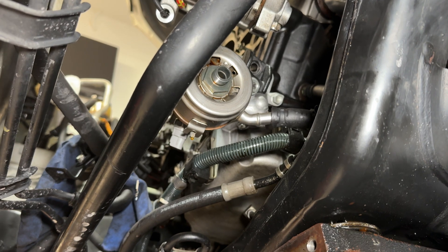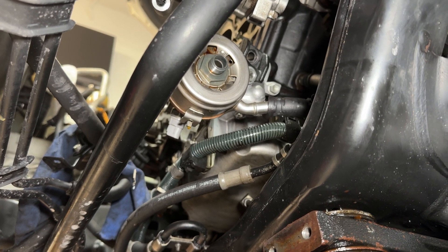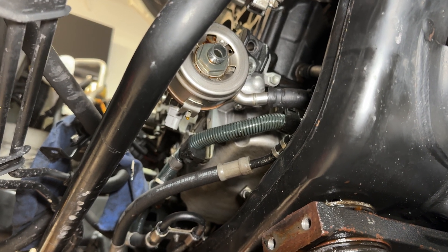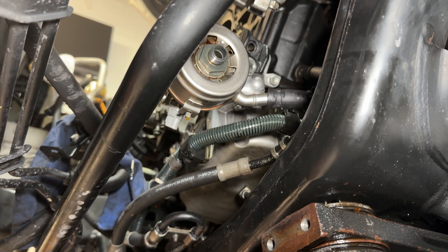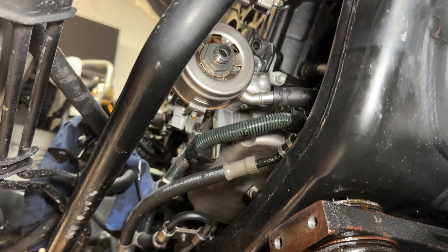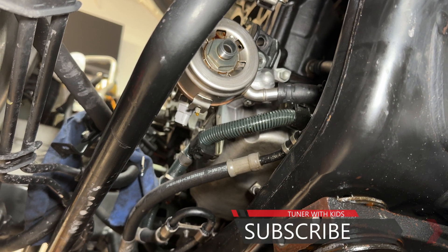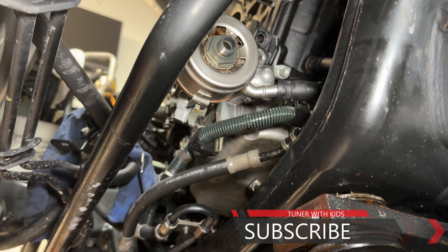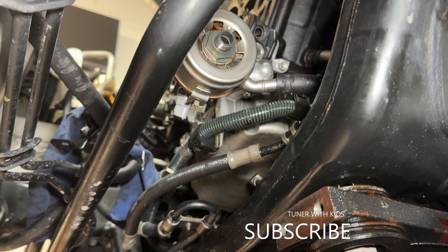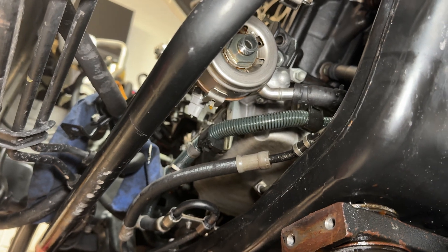Underneath here we go ahead and torque it to 51 foot-pounds and we're pretty much done. I want to thank you guys for watching all the way to the end of this video on how to change the seals on your oil cooler. If you guys have any kind of mysterious leaks or leaks coming out of this area, that's most likely the culprit — those three seals. If you found this video useful give it a thumbs up, go ahead and subscribe to the channel. Remember, for all these different projects, if I can do it, you guys can do it. Thanks for watching and I'll talk to you guys next time.